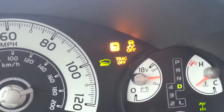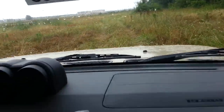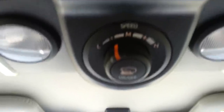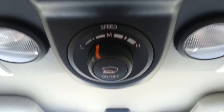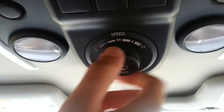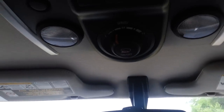It's flashing the traction control to let you know that you don't have traction control right now. I'll generally just let off the brake and I won't even touch the gas. It kind of sounds rough, but it's actually the anti-lock brake system pulsating the brakes to control the speed. In low, you're actually only moving at half a mile per hour per notch — we're traveling at one mile an hour blazing speed. I'll put it all the way to high — that would equal two and a half miles an hour.